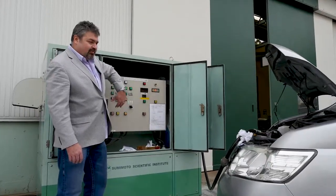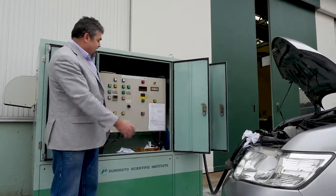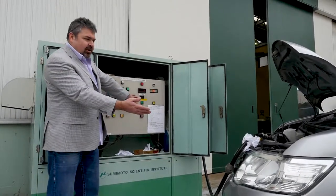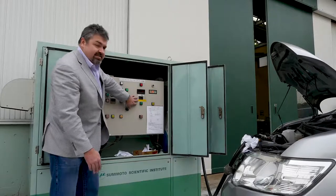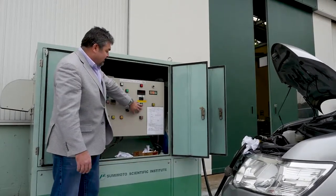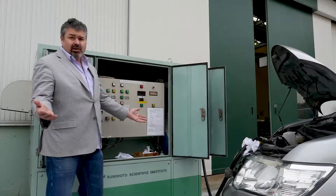This is the control system for the Nephron. After it's connected, you designate the amount of oil you need. Obviously, this is a small Nissan — it has 3.7 liters of oil requirement. The big truck would require more. You set it, you hit the start button, and in five minutes your oil's changed.